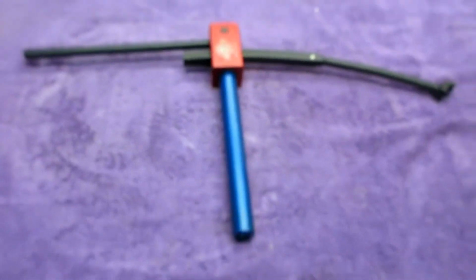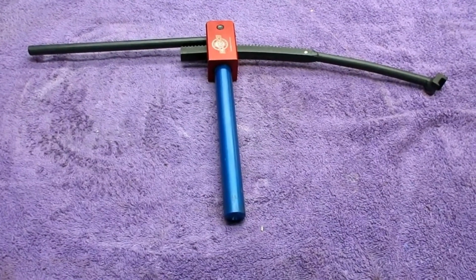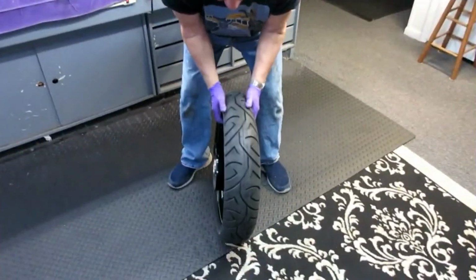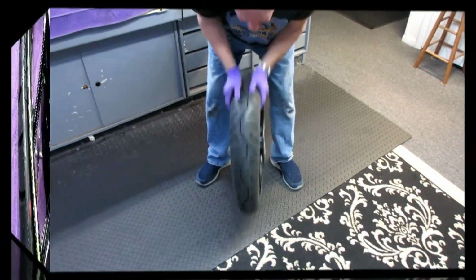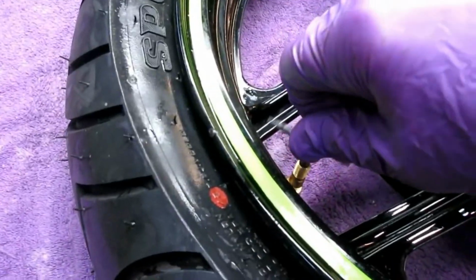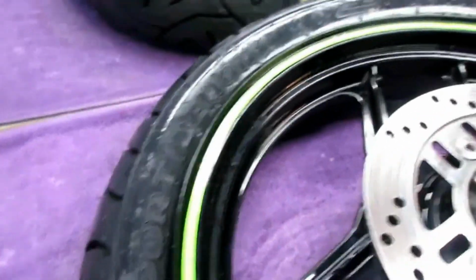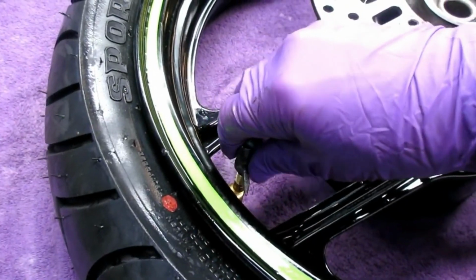I think I want to get the thing on its Bead No Pinch, and we're just going to clean this wheel up and get it ready for the day. We'll wait for a rainy day and get it mounted up. So we'll seat the bead this way, get the compressor fired up, put the valve stem back in, a little bit of Windex around the edge of the rim, get this to seat nicely, and then we'll check for leaks.